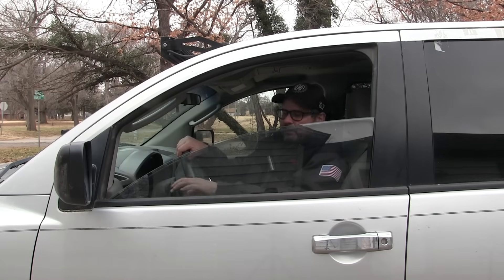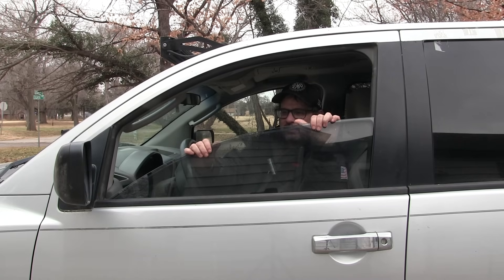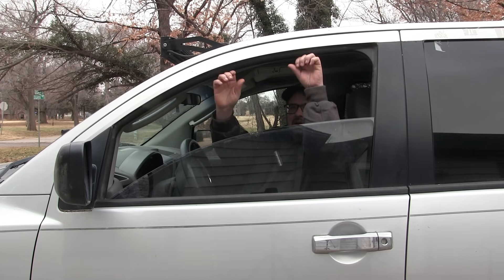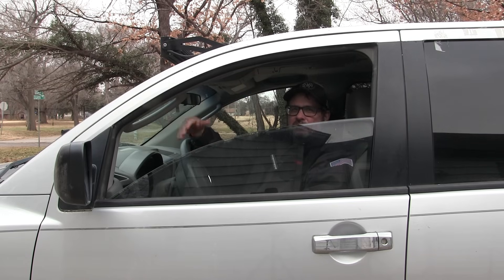If it is your window regulator and you hit your up and down switch, you're still going to hear it in there. Also, a lot of times if that cable breaks, you can get your window and slide it up and down. For a quick fix — like today, it's cold and nasty out here and I don't have the part, I'm going to have to order it — you can raise the window up and use some duct tape to go around the top and stick to the glass just to hold it for the time being.